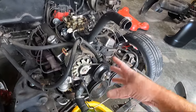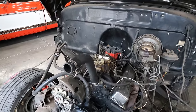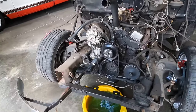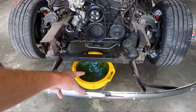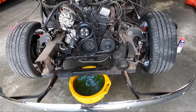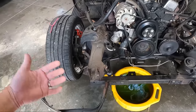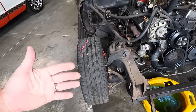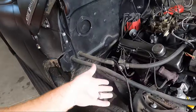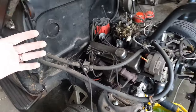I'm just going to go through and start picking stuff and unhooking it. I need to unhook the fuel line, the exhaust, the throttle cable, and the electronics for the distributor. I already unhooked the spark plug wires that went around the steering shaft. We have a lot of stuff out of the way — it's just going to make life easier. I think I am going to take the bumper bracket off. He obviously had to weld a bumper bracket on to make it fit the frame — you can see where he lopped off the front of the frame and the clearance he had to make. The goal here is to make things nicer as we go. I sprayed it down with some PB Blaster and WD-40 on the bolts I thought I'd have problems with.